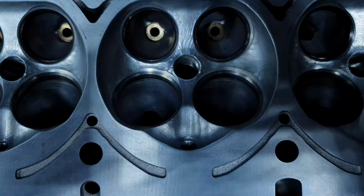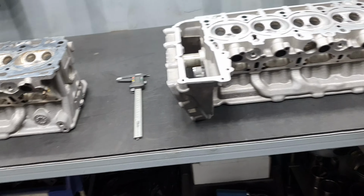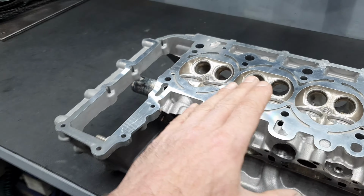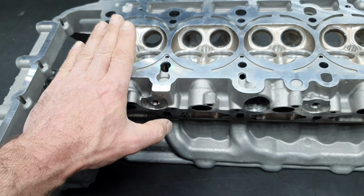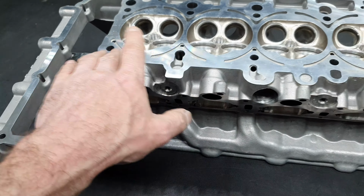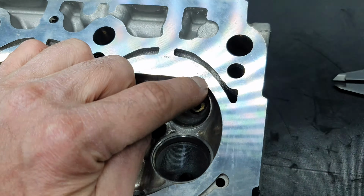Okay. Just some comparison. That's it for now. Nothing more, nothing less. One small update: I received the cylinder head. I'm waiting for the upgraded valves. Obviously, I have to lap the new valves, valve springs, retainers. Before I finish it, I want to get some measurements to see that it's straight. I also want to put the head gasket on to see where it sits.